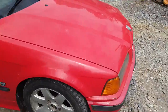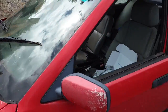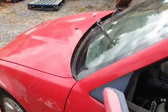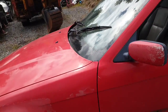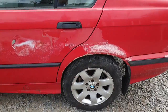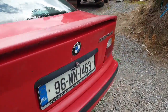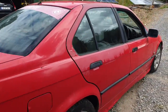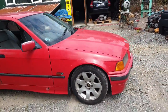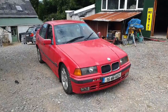On the EV side, left to do: there's some wiring tidying under the bonnet — not a big deal, doesn't need to be done today. Then I've got to put my heater matrix in. The good news is the fan still seems to work; the bad news is the windscreen wipers do not. Then we have the sills which need replacement, and although not strictly needed for getting road legal, I am going to have to paint the car and a few other odds and ends. I haven't decided if I'm going to do fast charging on this vehicle, but for the minute with the MG 6.6 kilowatt charger and our 14 kilowatt hour hybrid JLR pack up the front, it kind of doesn't really make sense to waste time on that.